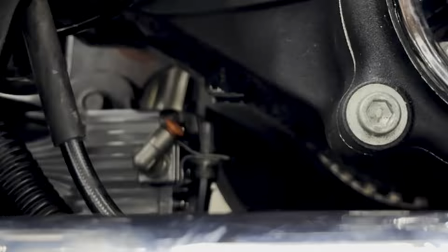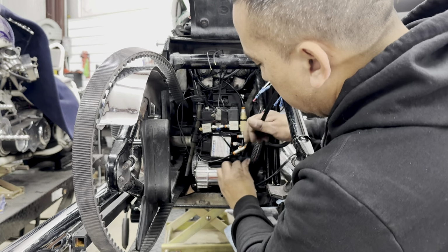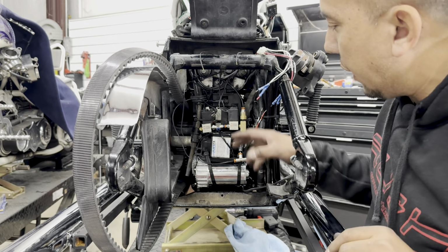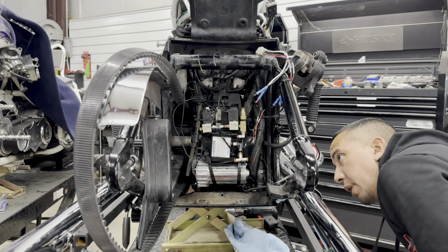So as you can see where we mounted this air compressor, it's perfectly centered. We've got that bracket on the inside that's holding it upright, which is good, but we're going to add some heavy duty zip ties on here. And now remember earlier I had said that this line is going to go directly into the air compressor. So at this point in time, now that this is secured, we can go ahead and make this line and lengthen it out to the destination of the air compressor, which is going to be right underneath. And we will do that now.